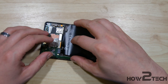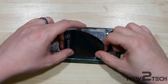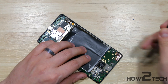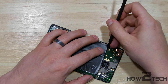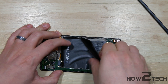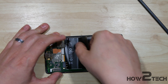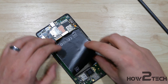The next portion is just this black matting. You want to line it up as close as possible — there are four cutouts for the rings down here that can help you get it to sit back in place properly. You may have to pull it up and realign it. You want to do this as few times as possible because the more you do it, the less adhesive is going to be on it and it won't want to stick down as much. As far as I can tell, this is purely cosmetic on the phone. It's not terrible if you leave this out, but if it's in there, it's in there for a reason, so we're just going to put it back in.